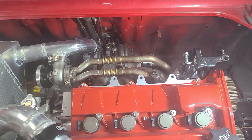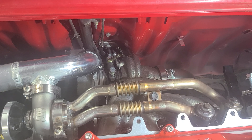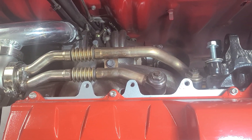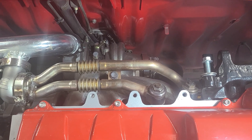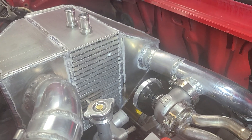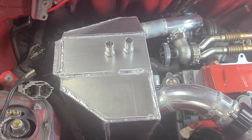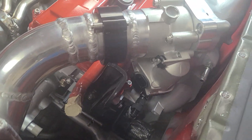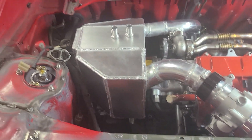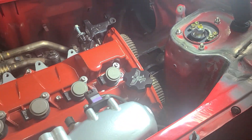I found an exhaust manifold from a rally car — that's actually Inconel. I've got a BorgWarner EFR turbo down below to spool things up. This is an anti-lag valve, and these are the fresh air supplies that will feed the turbo fresh air for a proper rally-style anti-lag setup. This is an air-to-water intercooler — the passageways here are coolant passageways, and the end tanks are where the compressed air goes through and gets cooled. I've got a drive-by-wire throttle body with my own designed throttle body adapter, and the whole engine is mounted in here with my own mounts.